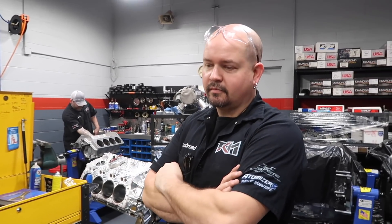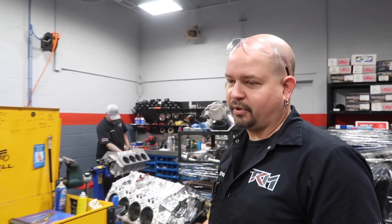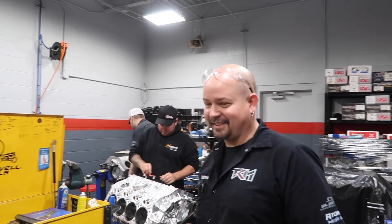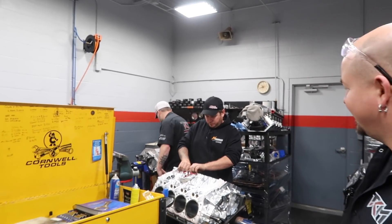I got up with the guys at T&D, so we're going to get some rocker arms. And then I guess really push rod length — what you'll do with the new rockers is check the valve clearance and measure for push rods, then bolt the heads down and we'll set the rocker arms. I mean it really won't take long, just whatever to get some rockers. So I guess we need to yell at Jason Brazl to finish my car. Your car or my car? Well your car first — I'm next in line after that.